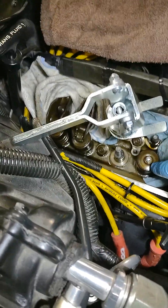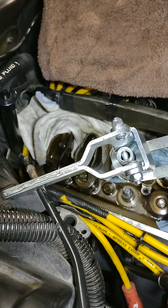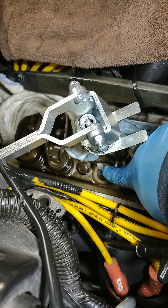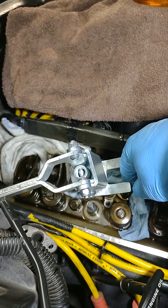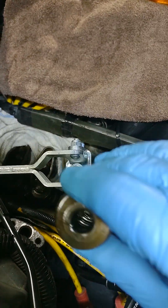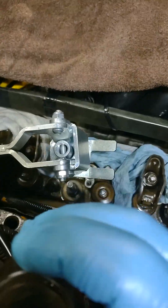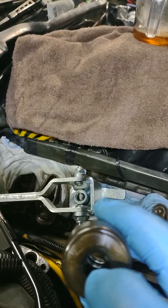The hardest part is getting — once you get this spring pressed down, you got to get this little o-ring down inside there. You got to put this on first, compress the spring, and then get that seal to go down on that second groove in the valve where it needs to be. That's a little difficult to do with this spring compressor, because when I compress it down it wants to shove the spring all the way up against the top part, and you have a hard time getting that little seal down in between the valve and the spring holder.